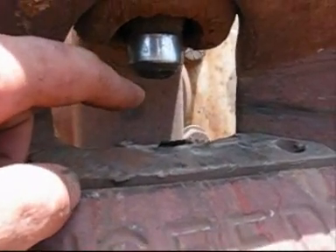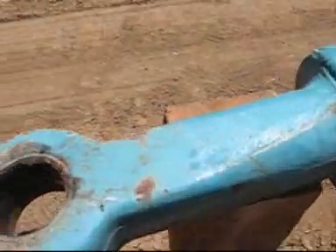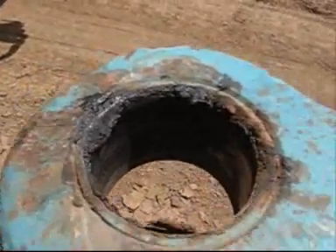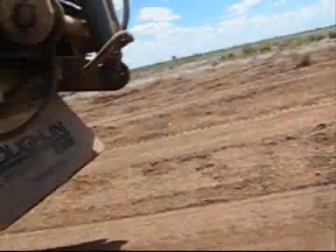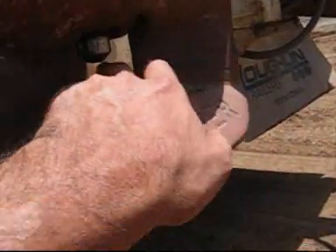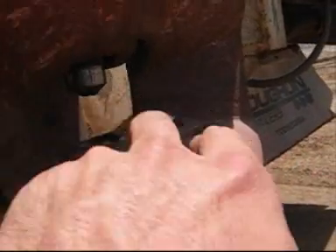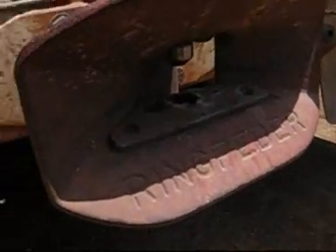You can see the pin there is in the up position, ready to be fed. Now, what goes into the ring is this eye on the end of the dolly drawbar. The bush inside the eye is a straight bush — it's not machined out to a curve or anything like that. As you can see the angle I've got it on here, as I back the trailer back, the taper on the bottom of the ring will rub against here. You always leave it a little bit lower, not higher, because it has to clear the pin. What happens is the thickness of the ring, as it goes into the ring feeder, will hit the taper on the bottom of the pin, pushing the pin up as it goes past, which releases the lock, and then once it's fed into the ring feeder, the pin will drop automatically back into the hole. So I'll back up and you can watch the way it works.